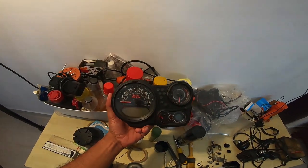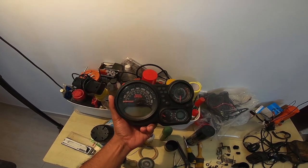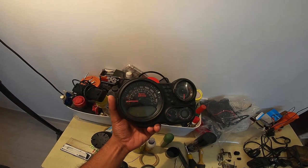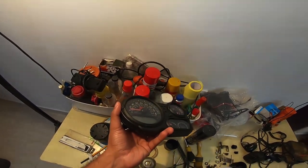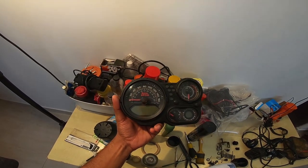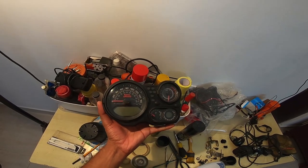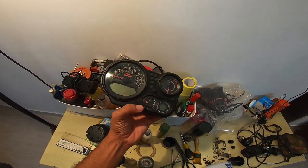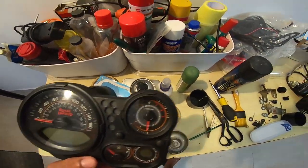So I believe this is going to be the next upgrade — matte black painted instrument cluster. I did not document the process because I'm not recommending this as a DIY unless you know how to paint. I could have used a heat gun to pull the plastic rings out, paint them separately, and put them back with adhesive — but instead I just straight away masked these areas with masking tape, cut it to shape, and taped off all the surrounding negative space.